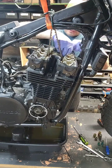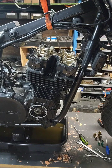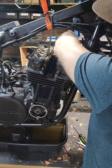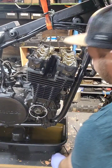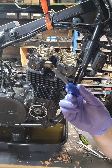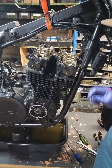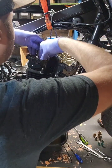There we go — got both of those bolts. This slides right up. For the bolts, since I'm not doing anything crazy with the cylinder head, I can just put these right back in so I don't have to worry about storage space or risk losing them. The dowel rod did pop out — here is the little dowel rod. Nice and hollow, but very important, good for spacing. Slide it back in there and boom. Move on to the intake side.